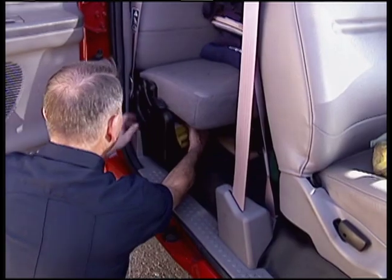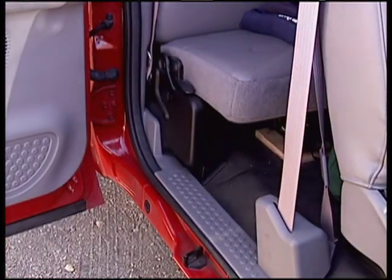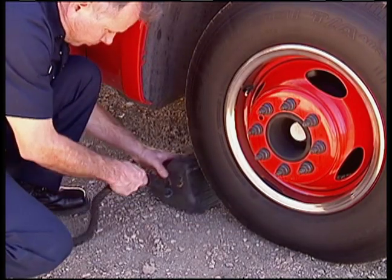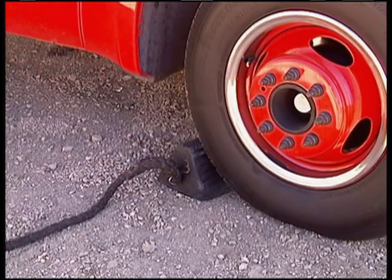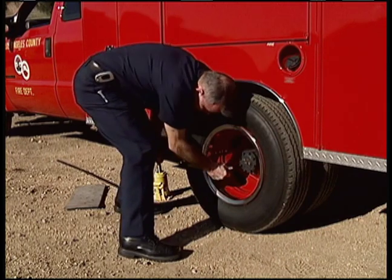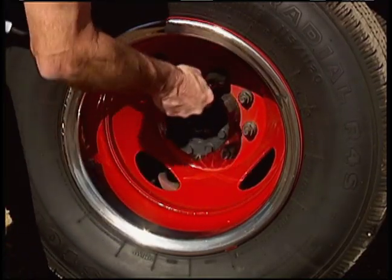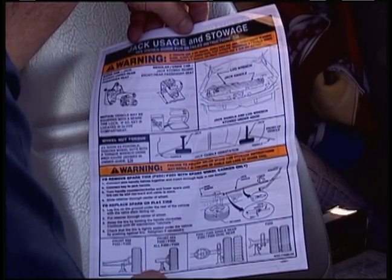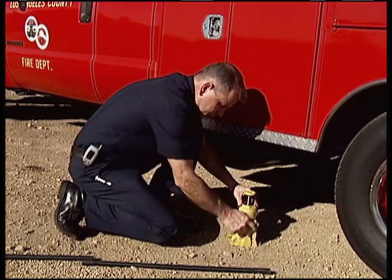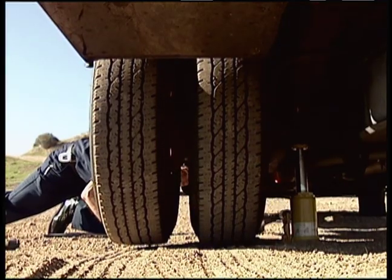Locate and retrieve the hydraulic jack provided for your vehicle. Place a chock block under the wheel on the opposite side of the vehicle on an axle that does not have a flat tire. After placing the chock block on the downhill side of the tire, allow the vehicle to gently roll against the chock. Remember to reset the parking brake and transmission. Prior to raising the vehicle, loosen each lug nut approximately one turn counterclockwise using the lug wrench. To save time and effort, raise the jack close to the height needed before placing under the vehicle. Raise vehicle until the tires are approximately two inches off the ground.